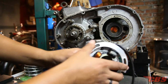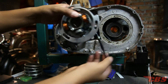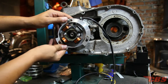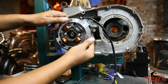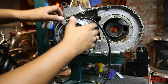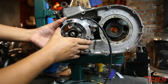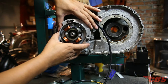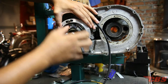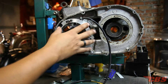After these parts are installed, take your stator — I like to make sure the wires are up, not down. Take your stator and put it on your three alternator studs. The way I'm installing this right now is the same on singles and twins. Sometimes you have to wiggle it on there. Make sure you set the stator plate in the center so you have full throw in both directions. If you're familiar with points, you know exactly why that is.